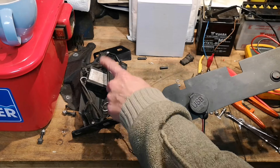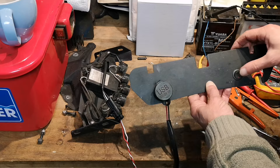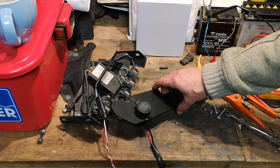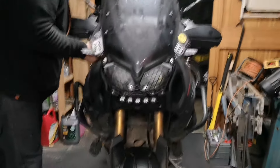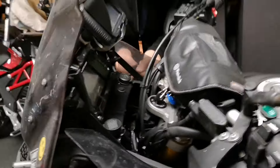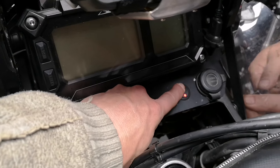I'm going to take the live from this to the middle of the switch, middle of the switch to the headlamps, and then the ground coming back to ground. I'm also going to loop a ground from this gold one over there, because then when you switch the lights on there's a little red LED that tells you they're on. So we've got power — there's going to be another power in there too. So there's the cheeky little light bar, all straightened up after the crash on the old bike, and we've put a bit of a dashboard plate in here — you've got permanently live USB and permanently live headlamps as well.